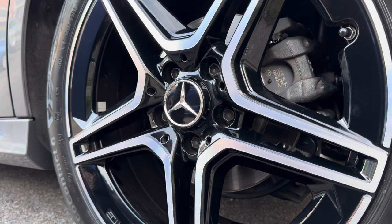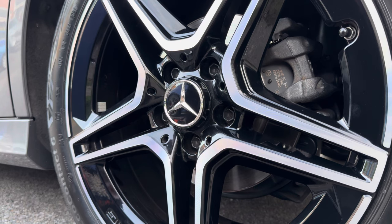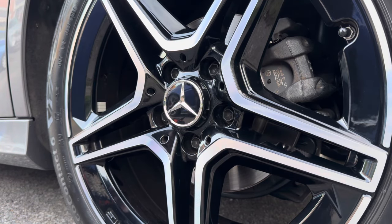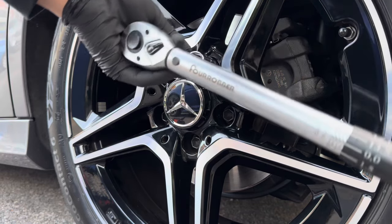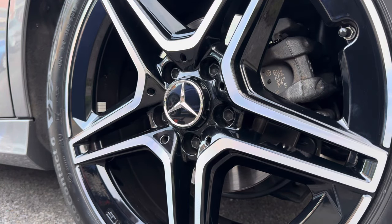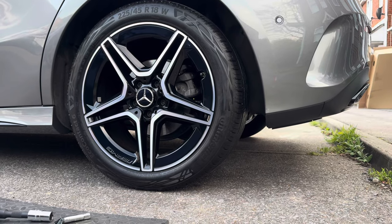The camera wasn't in focus during part of that torquing — I'm really sorry about that. I'll loosen one and redo it just for the video's sake, so you can see it properly this time. Loosen it, tighten it until it stops, and then use the torque wrench — click. Count to five, one, two, three, four, five — and there we go. That is how you torque your wheel. Looking fresh!